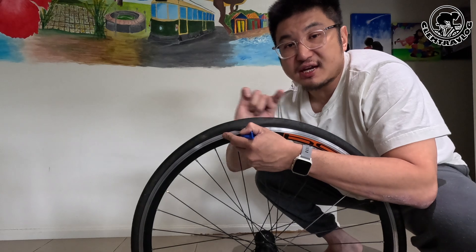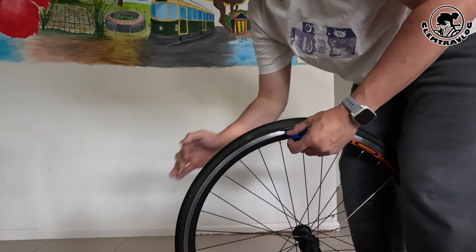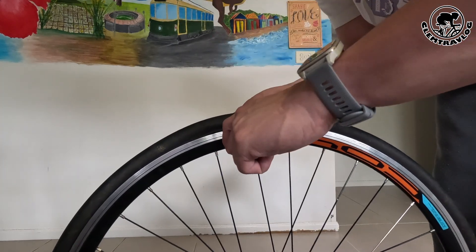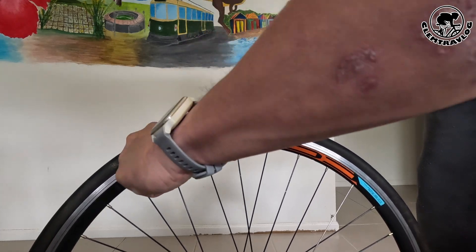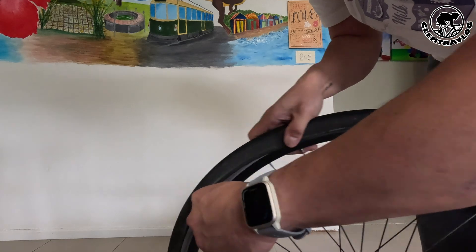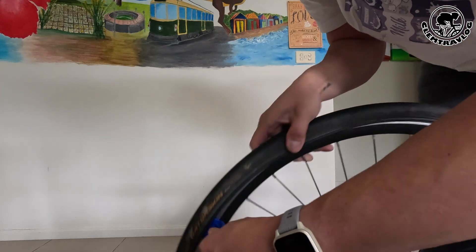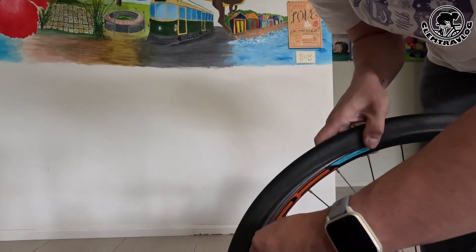To make it easy to get the whole tyre out, stand up and give a little bit of pressure — stand at 90 degrees, your body at 90 degrees. Hold it like a handle and push it around. Look, you can easily glide around the rim. Now the tyre is entirely off. By standing up with the 90-degree pose, it gives you a little bit more pressure to glide and push the tyre out.